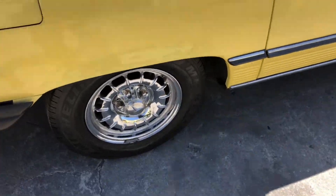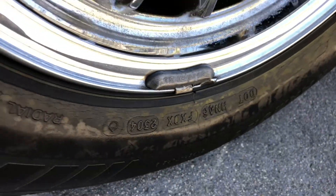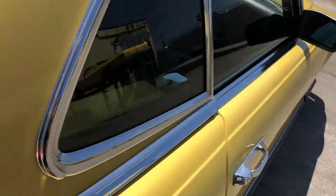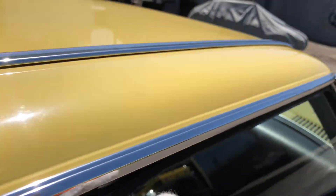Right rear wheel — again, the chrome. Here you can see the sidewall cracking, and you can see where a little chunk is missing right there. There is a DOT number of 04. Here you can see where the rubber is dried and deteriorated.